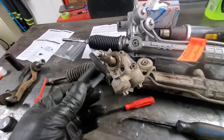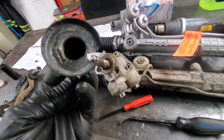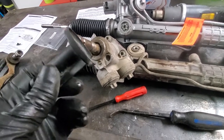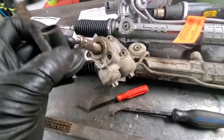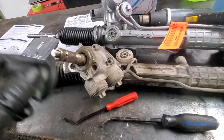I tried to remove this piece and a bit broke off. What I figured out: use a heat gun — when it's nice and hot you can remove it with your fingers. Don't force it too much with pry bars; just use a heat source, let it expand, and then pull it off.